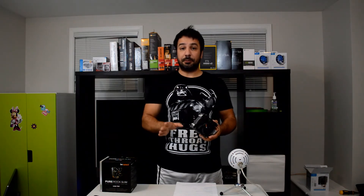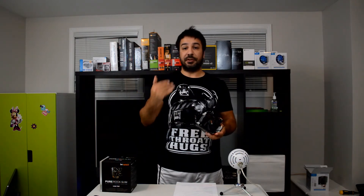Overall, coming to the conclusion: do I recommend this cooler? Is it a good cooler? Honestly, I am really pleased with the product Be Quiet has delivered. It's not the best performer, and if you are aiming for top-notch overclocks on high-end processors like a Ryzen 5 1600X or higher, or an i5-7600K or higher, it's probably not going to be the cooler for you. However, if you have a processor like a Ryzen 3 or an i3 and you're overclocking, this will probably get you all the way to the maximum you can push it.